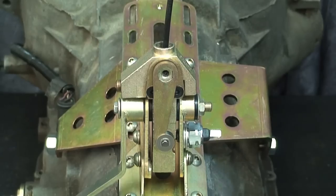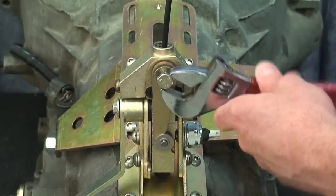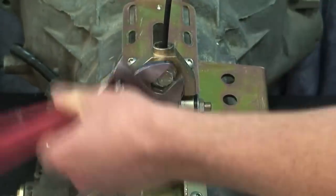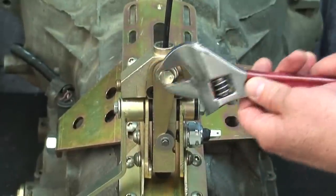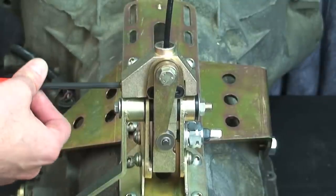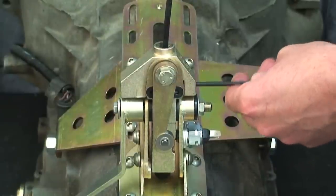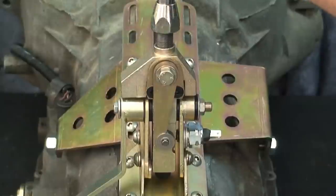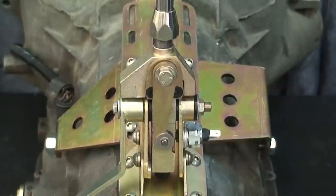While the shifter is in neutral, install the side shift activation arm so that it almost touches or rests on the roller bearing. Then use the washer and bolt to press the arm onto the hex boss. Set the activation spring to your preference for side shifting gears. Set the shifter arm in neutral, then tighten the set screw until it makes contact with the lower shifter body. Reinstall the shifter arm and trim the surplus cable if needed.